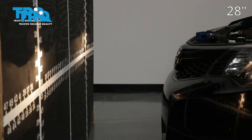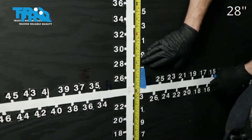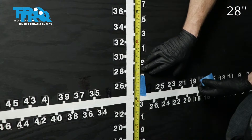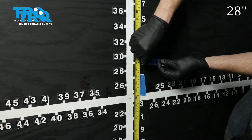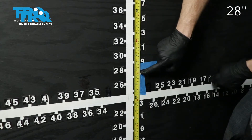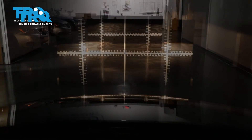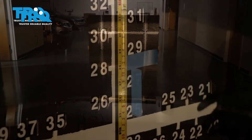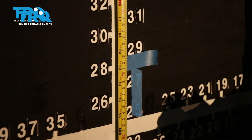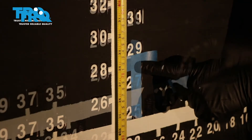Next, we need to measure from the level ground up to this point and take note of that measurement. Now we're just going to pull the car up to our wall. On our vehicle, the measurement was 28 inches for our axis point. Your vehicle may be different, but that's where I'm going to put this tape, just above that 28 inches. We'll do the same on the other side. Let's just back the vehicle up straight back 25 feet from the wall. Now that we moved our vehicle 25 feet back from the wall, we're going to start with our measurement here — that's where the headlamp center is.